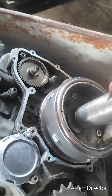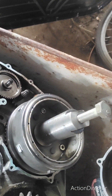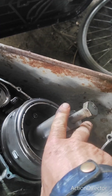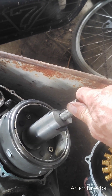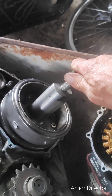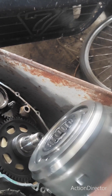At this point we put our puller on here and turn it until it bottoms out and won't turn anymore. Then we wind the inside of our puller up until it touches, and you hold your crescent here and a strong bar here — it takes a lot of turning. You turn it, you turn it, you think this is going to break something, and then you turn it a little bit more and it goes bang.